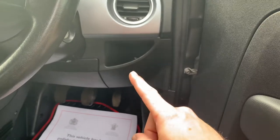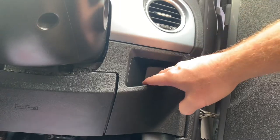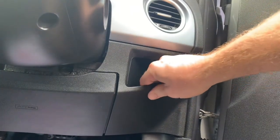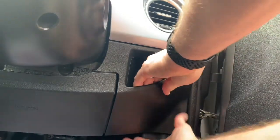It's one of those that's tucked away behind a piece of plastic, and there's a little knack to get it out. You have a small drawer here where you'd put change and whatnot, and the OBD port is behind it. If you just pull the drawer straight forward it won't come out — the best way is to get your hand up underneath the plastic at the bottom and slightly lift up and out.